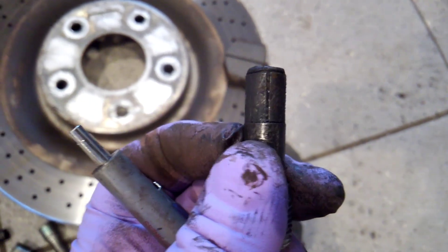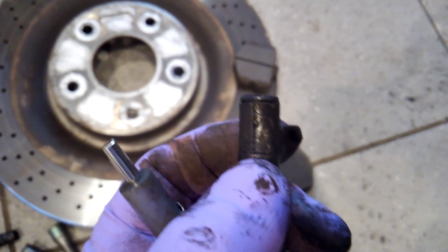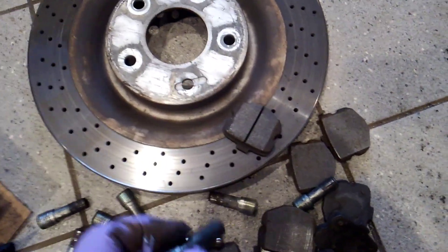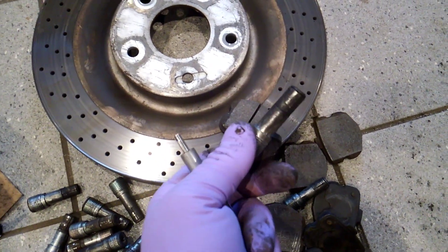See, there's the slot right there. That metal shim will actually conform to the brake pad contact points right here. So if you're going to do a Grand Sport Z06 in the 6th gen correctly, you do OEM pad and you do the pins.